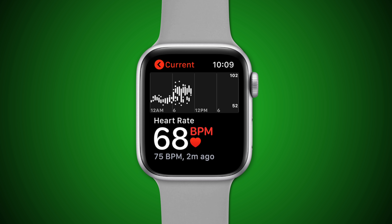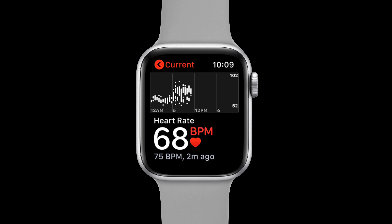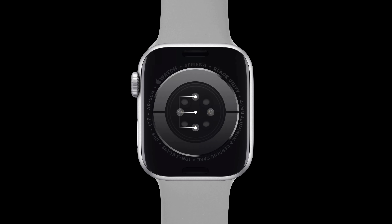You may have noticed that the green light isn't on constantly, despite the Apple Watch recording your heart rate throughout the entire day. That's because Apple included a second way to measure your heart rate using infrared sensors. These use much less battery than the green LEDs, and are designed to take measurements in the background every ten minutes. The problem is they're not as accurate, so if the watch detects an issue with the infrared sensor's accuracy, it'll switch to the green sensor instead.